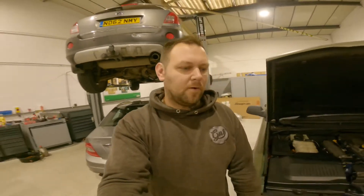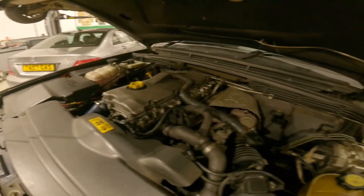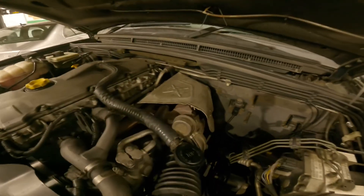That's the exhaust manifold all put back together and tested - no blows on the exhaust now, which is great. So manifold all skimmed, new gasket, all new studs, new nuts, and ready for collection. Heat shield back on the exhaust. We'll ring the customer now and he can come pick his car up.